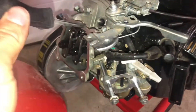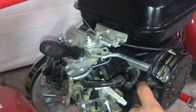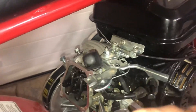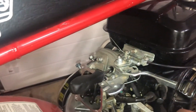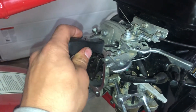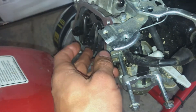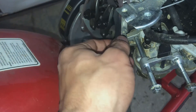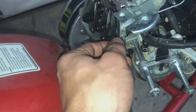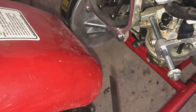Now that I got the rope out, I can take my screwdriver and put it down there and feel and watch the valves until I get to top dead center. And then I can set my valve lash. I can take my feeler gauge and slide it in here, then tighten the nut until I can snugly wiggle it back and forth, and then tighten down the lock nut. For intake I'm using 0.004 and for exhaust, 0.006.